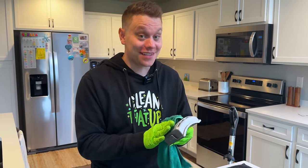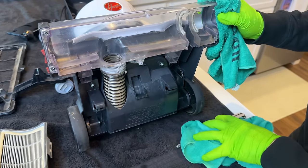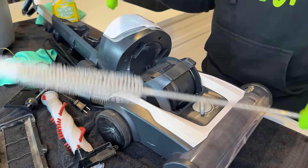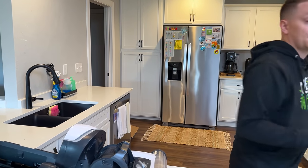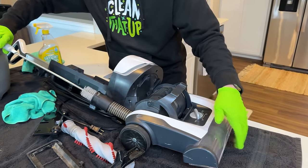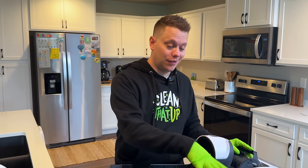This vacuum is a lot dirtier than I anticipated. One area to note is this tube here — you can't remove it, it's completely attached to the vacuum cleaner, but sometimes it comes out through the back. What I like to use is a dryer vent cleaner — it's normally used for your dryer lint trap area. You can also fish a microfiber towel through with an old coat hanger if you don't have one. This just pushes right through the hose — it's nice and bendable. So the main machine is completely wiped down, along with those parts I just wanted to wipe by hand.